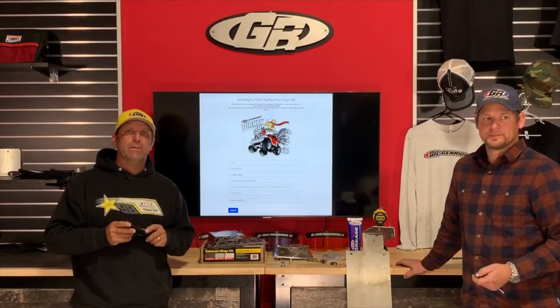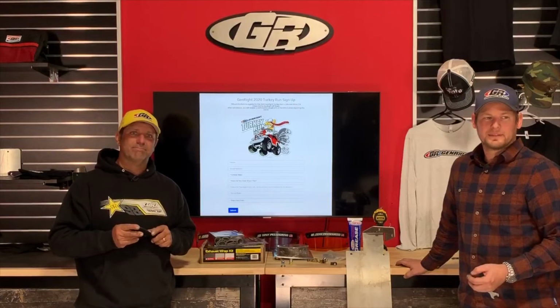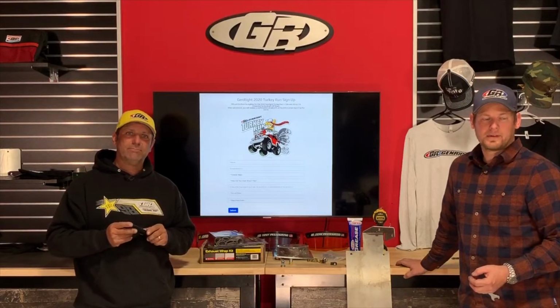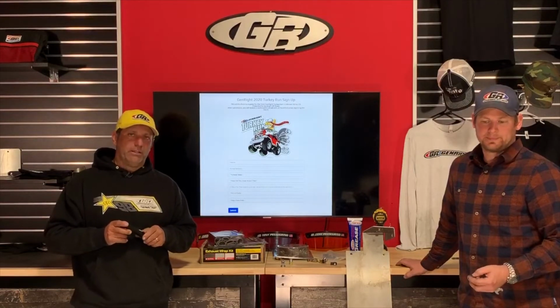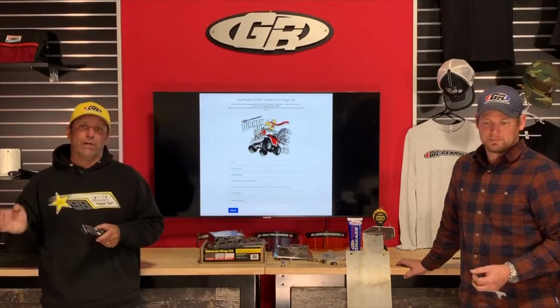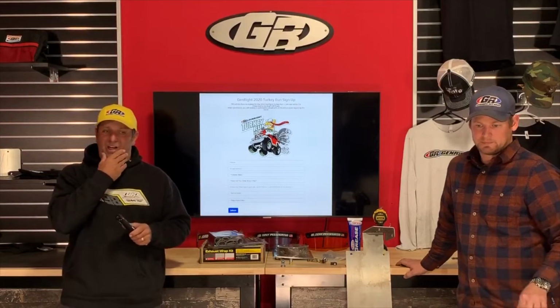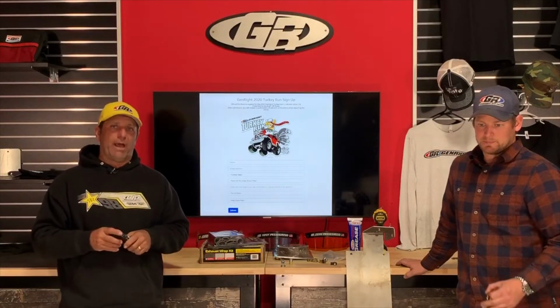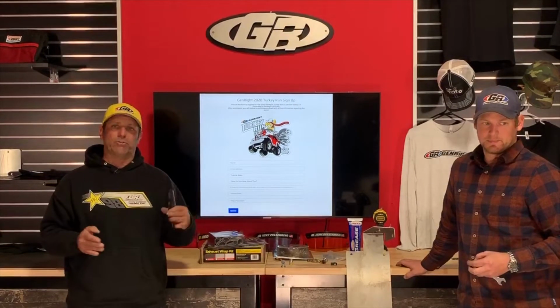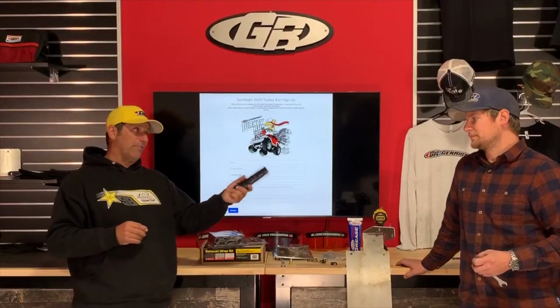Neil Overstreet asks: 2 or 2.5-inch coilover shocks? Why do I need one size over another on a Jeep? Okay, Neil asked about 2-inch or 2.5-inch coilover shocks, and why do you need one over the other? The bigger the shock you go, the more dampening control you have. The springs are the springs, right? So if you're running a 200-pound spring or 250 spring,